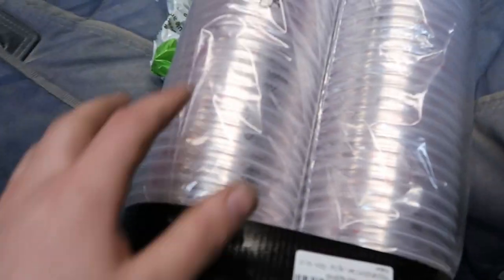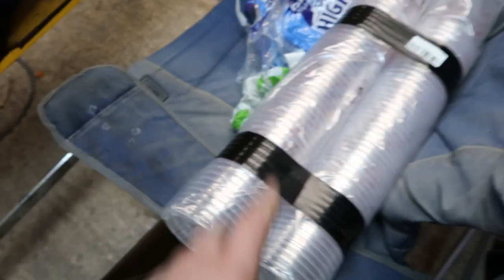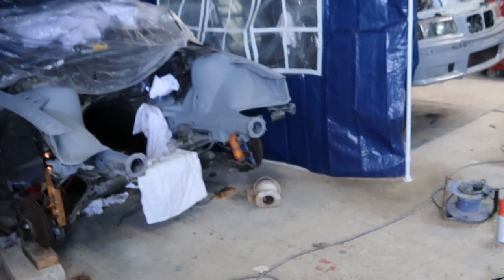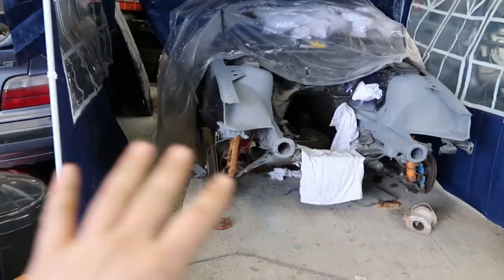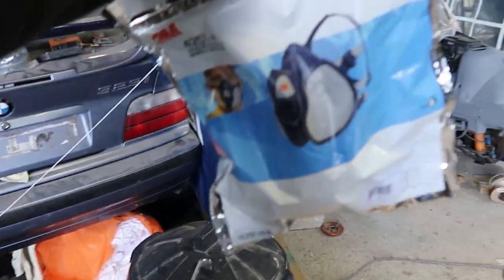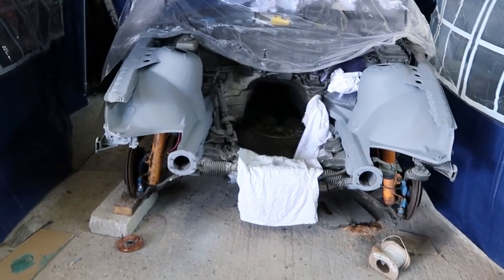I've got some mixing jugs here - I only wanted like one or two but you can only buy a pack of 50 or 100 apparently. We've got a spray gun here, and another one somewhere as well. I've also got this little heater that I'm going to put in there to try and warm it up a bit, because you're supposed to paint at about 20 degrees and in here it's probably about 10 if that. It's quite windy in here as well. I'm going to tape it all up and put the front across, lock myself in there and spray away. Also got this mask - make sure you use a mask if you're using proper spray paint, not like can stuff, because this stuff is really strong and poisonous. You don't want to be breathing that in.